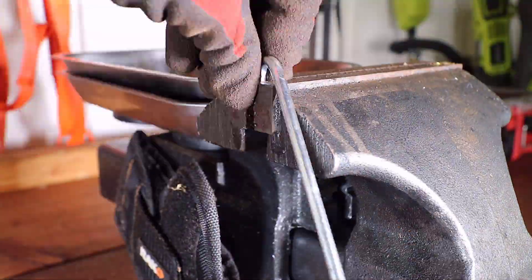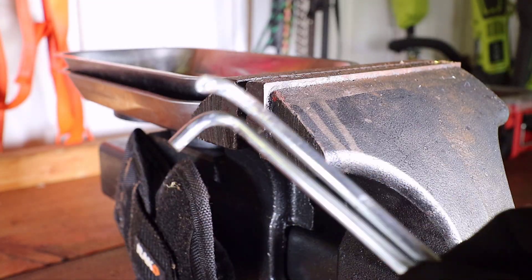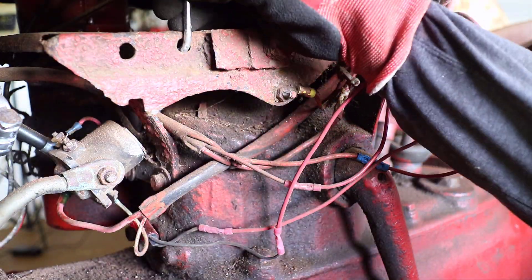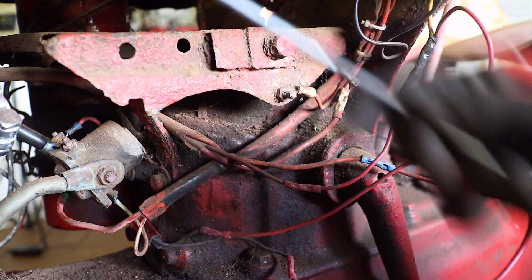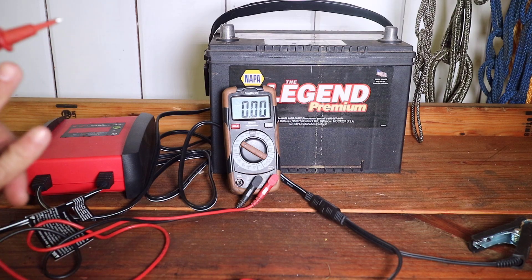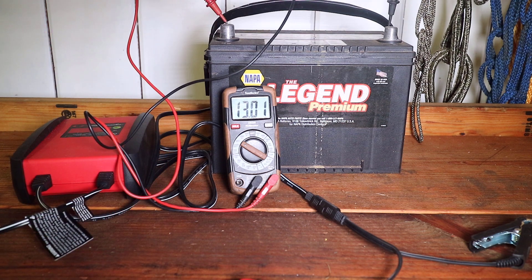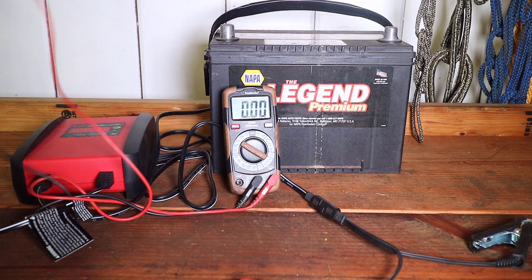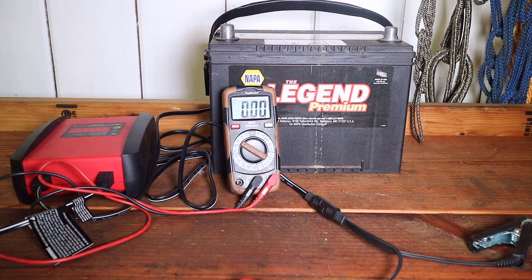Because of this I decided to bend the J shape into an L shape, or a 90 degree angle. This would allow the rod to be inserted while facing upward in the direction of the battery. With the rod ready, it was now time to check the voltage on the battery. As seen, it was 13 volts because it was just recently removed from the charger, but it did drop back down to 12 volts after about a day and remained consistent after that.